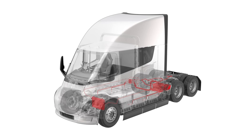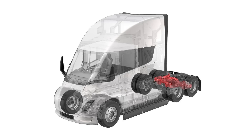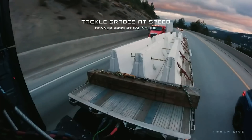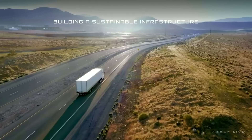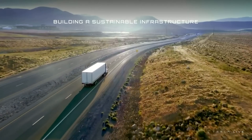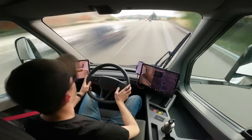The mega cooling modules and the two rear axles named torque and efficiency. We can identify the efficiency axle with its single engine in the very back, and the torque axle with a pair of engines just in front of that. That torque axle is reportedly only engaged when the vehicle is under heavy load or acceleration. Otherwise, the efficiency axle, which is optimized for constant highway speeds, is what the Semi runs on.